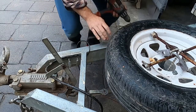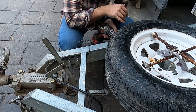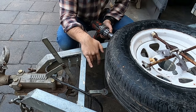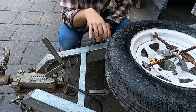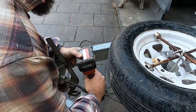Of this chassis rail, there's already a hole which has been pre-cut for some reason, I'm not sure why, but it's there, so I'm going to use that as a point of entry for my wiring to come through this drawbar channel. I'm going to drill a hole at the bottom side of this channel here so that I can feed the 7 core through. We'll pop out here and this is where we'll do the connection for the plug.